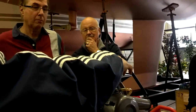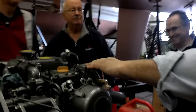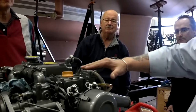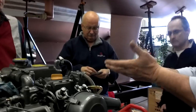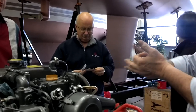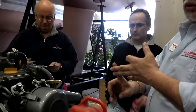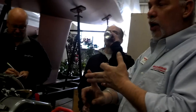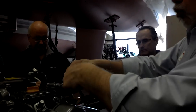I saw you doing something with this thing with somebody else. What this is, is a crankcase ventilation system — to where we want to pull vapors out of the crankcase. We don't want to have air in there because inside the crankcase we have air, we have fuel, and we have heat. In large diesel engines, it's very likely — if you have that combination — for the crankcase to explode. I actually had one explode on me when I was 18 years old, and just as I walked past the flywheel, the lower connecting rod came out of the engine. The connecting rod was as tall as I was.